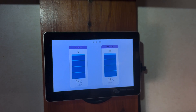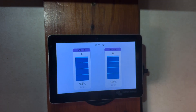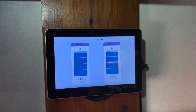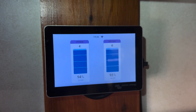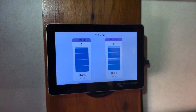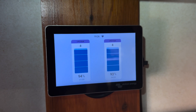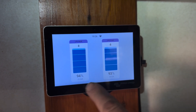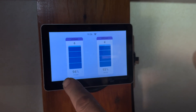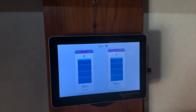From our point of view we're more interested in seeing the actual usable gas - we don't want to show the 20% because you're only meant to fill up to 80%. So when you've totally filled the tank, check what the values are and set that as your maximum, going from 0% to 100% of your usable LPG. This we believe is pretty accurate - we filled up not long ago and have used very little.